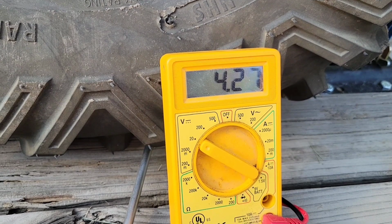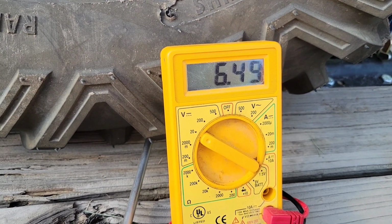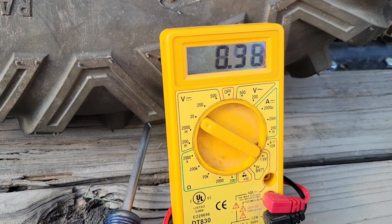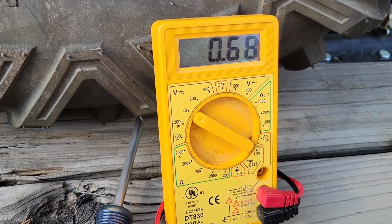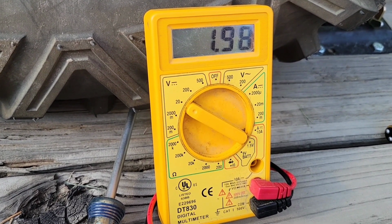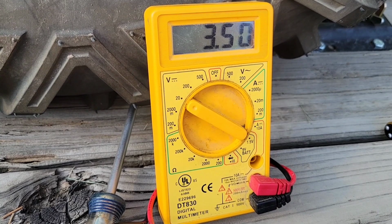So why does it not work when there's a bulb in there? The fact that this is the exact same thing that happened with the other light fixture tells me it's not the light fixture. So from here we need to follow the wiring back to where I intercepted that left turn signal at the back. That's what I spliced into when I installed these lights.